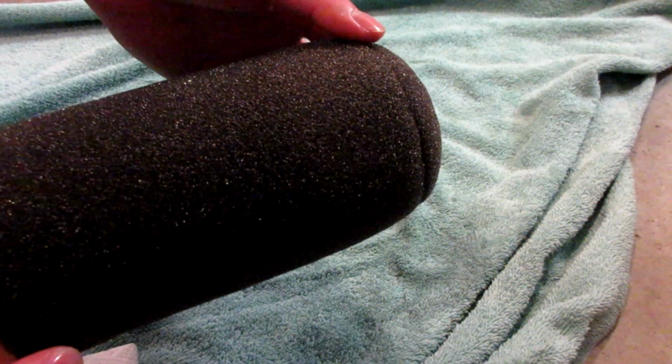So one tip I have for you guys, just to know if your filter is properly oiled, is to just spin it, and if it glimmers a little bit in the light, you probably have enough oil on there, so it's good to go. So now that our filter is properly oiled, let's go install it.